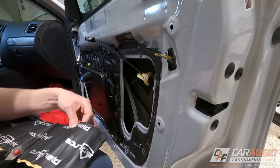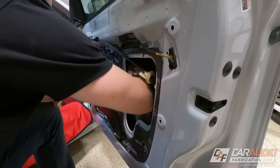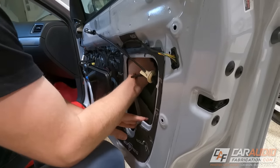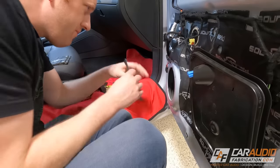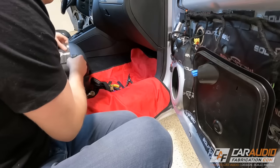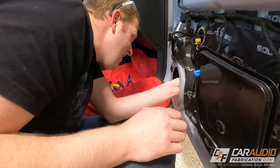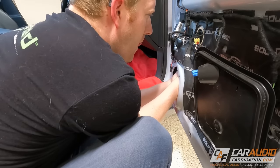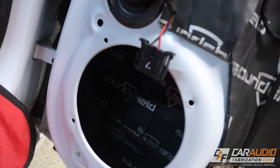I want to reiterate the law of diminishing returns here. If we get something like 25% panel coverage on the inside of the door, that's going to get us something like 90% of the performance benefit. Everything past that 25% doesn't get us the same amount of performance increase as that initial amount. While 100% coverage would be beneficial, I want this to be obtainable budget-wise for the vast majority of people watching. If we're smart about where we place the majority of materials — in this case putting more material near the speaker itself — we can get the vast majority of the benefit. Now we can do the classic knock test to hear how quickly the vibration stops.